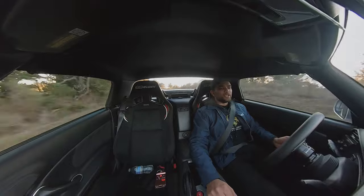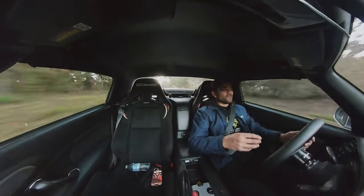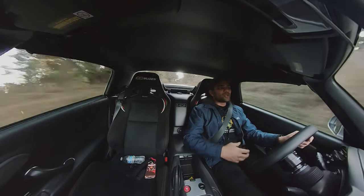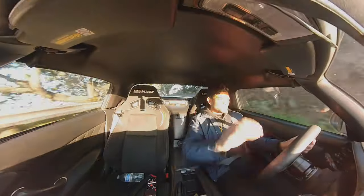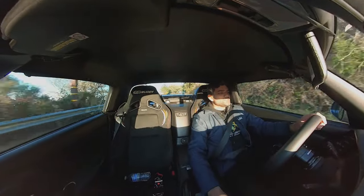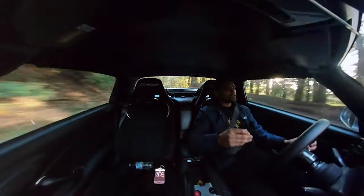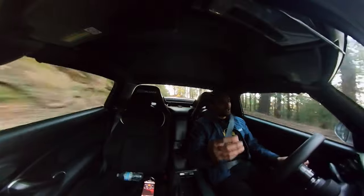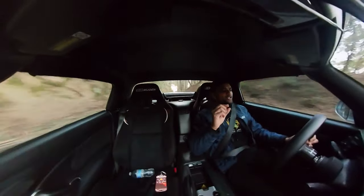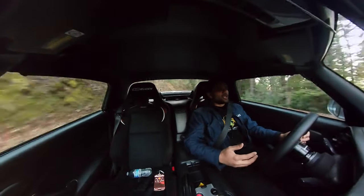My goal for this car is that in like 10, 15 years I'm going to be able to teach my daughter how to drive a manual in this car. And by then I'm hoping to have done enough suspension upgrades, modifications, and just overall refinement to where this car doesn't feel like a 30-year-old Honda in 10 years. Of course it's not going to feel like a brand new 911 or anything like that, but as long as I can kind of refine it over time I'll be really happy with it. So for those reasons I feel like this is a great mod — I almost don't even feel like it's a mod. I feel like this is something that every S2000 owner should consider as a maintenance item. The rigid collars essentially act almost like a bushing — it's a pliable metal, so it's technically a one-time use product. Once you torque everything up, the rigid collars actually crush a little bit and they kind of fill that gap in between your frame and your subframe. So for those reasons I think it's a great mod and I recommend it. Just make sure that you know what you're doing because as you saw earlier in the video it is a little tricky — it's a tricky install.